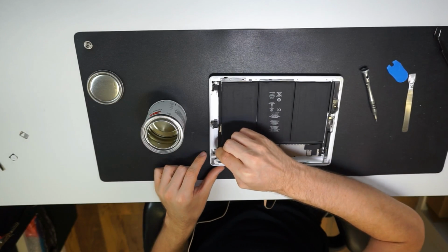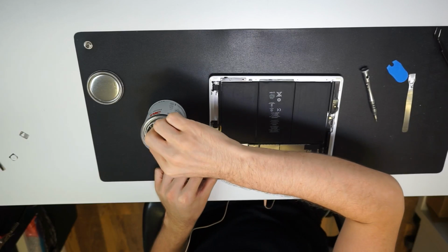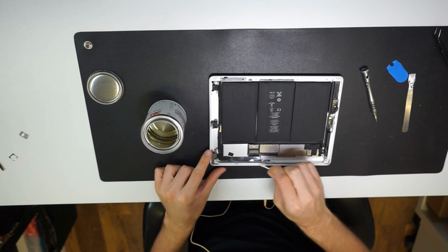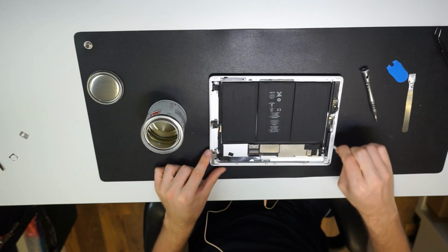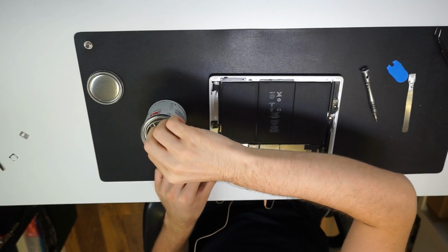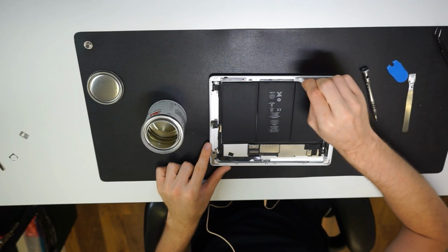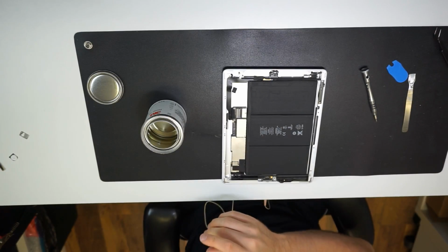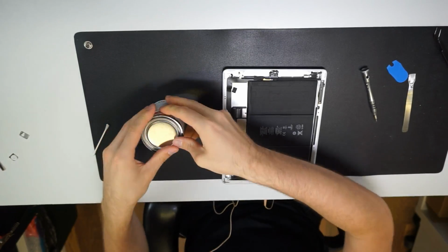And this will hold really well. So if you have lifting screen issues, this is your solution. Polish the frame completely, add primer, and add your own adhesive, which I will get to in a minute. So that's done. I'll still leave the cotton bud here because I'll need it for the screen.